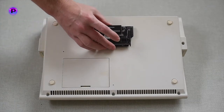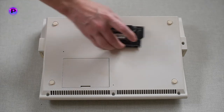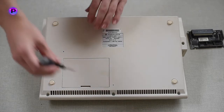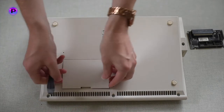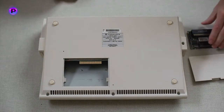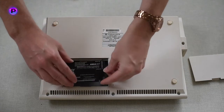We're now at the final steps of putting this Amiga 600 back together. There's just a small little upgrade to do, which is to add 1 MB of chip memory to the trapdoor slot at the bottom of the machine. This is very easy to access. Simply get a flat-headed screwdriver, pop the little plastic panel underneath the Amiga 600 off, and just push in the memory upgrade. Yours may vary, but these upgrades are very plentiful and actually quite cheap, and adding an extra megabyte of chip memory will give your Amiga the maximum graphics and sound memory that the custom chips can access.